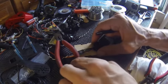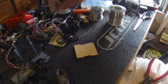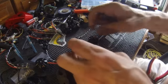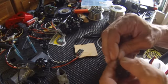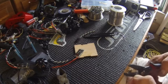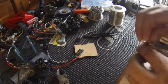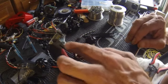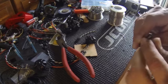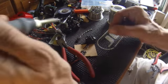Okay, let's grab another one. If you do this always the same way, you're going to get it right. So there's number one front. I'm going to take another one and another ESC — again backwards — and this is going to be number two on the side. Let's see the length of some of these, and we'll take off a little of that one. I like the middle one, and we'll take off a little of this end one. A lot of guys pre-tin these pads off your ESCs and it's a good thing.